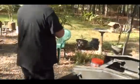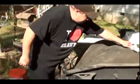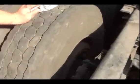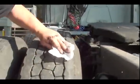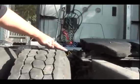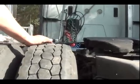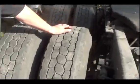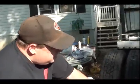So that one looks really good. If you have 4 or 5 thousandths of an inch backlash in these newer style axles, this is what it ends up looking like after 250 or 200,000 miles plus. I don't know if you can see that with your camera, kind of get in low on it like this. After a couple hundred thousand miles, you're going to get a little bit of step in the tire like this. Okay, it's normal even with these rear ends. It's sort of normal after 200,000 miles or so to get a little bit of this.